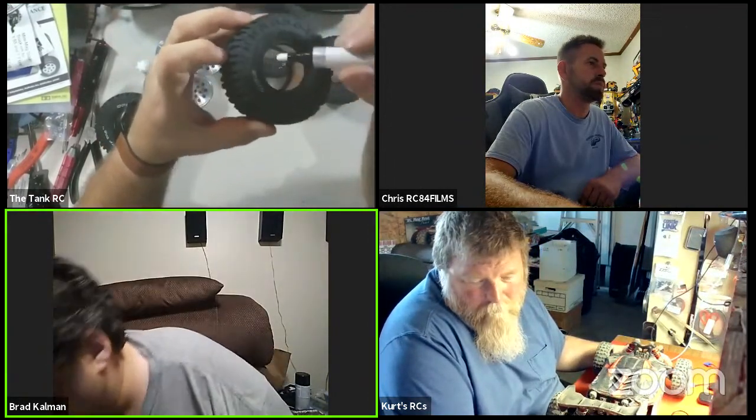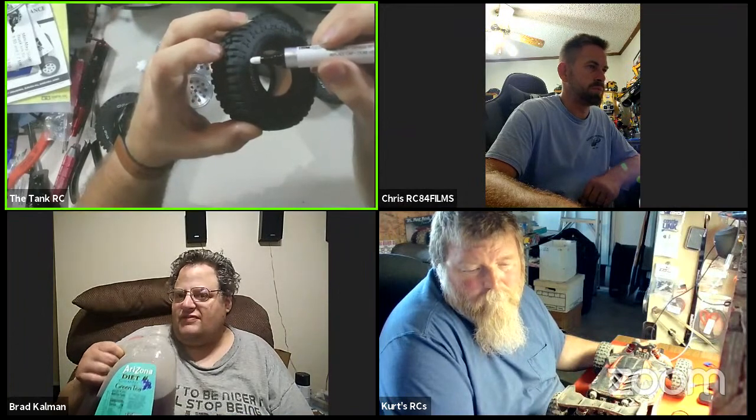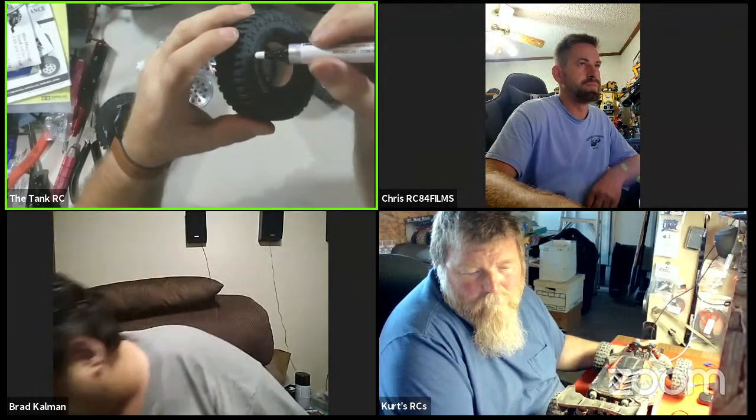Well, my car could take a 19 or 17 tooth, so I put the 19 in there because I wanted more top end, but I don't feel like I'm getting the top end out of the motor. I'm wondering if it needs to spool up faster. Yeah, but you're going to get top end, but it won't take off as fast. So it's up to you what you want.